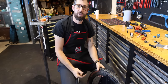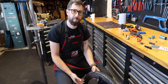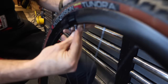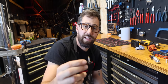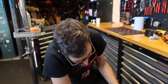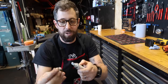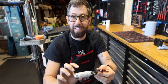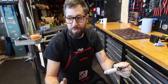Generally I'd suggest not using CO2 on tubeless because of the sealant, but in this instance you just want to get it bedded on. You can try with a hand pump, but sometimes it'll fail. I suggest removing your valve core — by removing it you get the maximum amount of air through the valve as quickly as possible. The valve caps actually have a core removal tool built in, so they're quite handy. At this stage try a hand pump, but if that fails use CO2. With the core out you'll get more air in, so even with a hand pump you'll have a better chance of success.